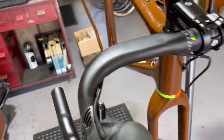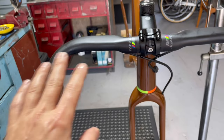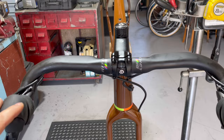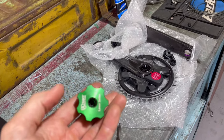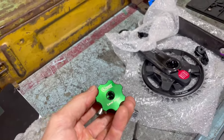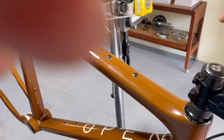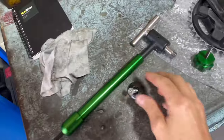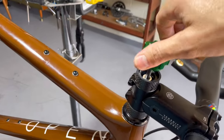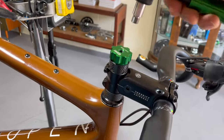While I'm pondering the cable routing, I wanted to check that I've got the levers set the same on both sides. We're happy with one side, so we want to set the other to be even in terms of height and angle. The way to do it is this tool from Abby Tools — it's called the Lever Setter. It's one of those tools that now that I have it I'm like, how did this not exist before? It's so simple and yet really clever. You remove the compression cap, thread the lever setter in where that cap goes, then take your hanger tool and thread it in.